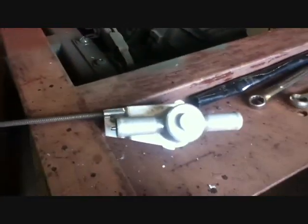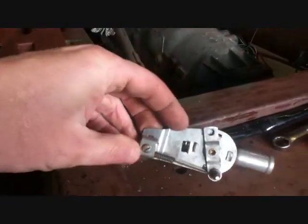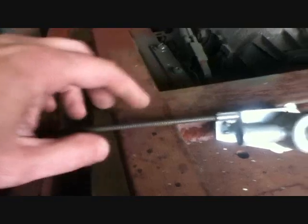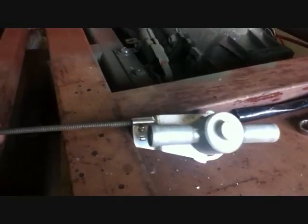This is your heater control — it didn't come with the heater. I bought it on eBay for like 15 bucks. It's a mechanical valve that opens and closes for your temperature, and it was like from a British car or something. The cable is actually from the heater — this thing was bought separate. That's how you turn your temperature up and down. It's going to go up near the engine somewhere and the cable will come out the firewall. But I'm putting things on, trying things out, and running wires. This was that vacuum switch — now it's a horn or a start button, whatever I want it to be.